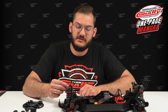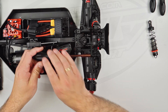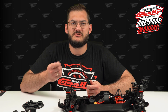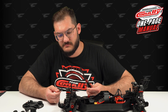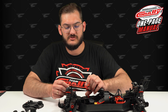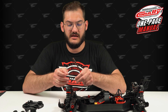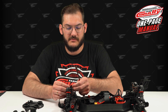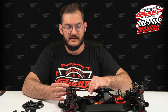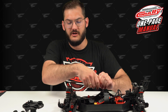In this manual you can also see how to take out the shock standoff — it's only secured by one screw at the very back. If you are only rebuilding the shock you don't have to disassemble this, but you want this shock standoff to sit tight. If the rear screw is loose and not fully tightened, the standoff can break. Make sure it's fully tightened with no looseness or gaps, because if there is, it will surely break sooner or later.